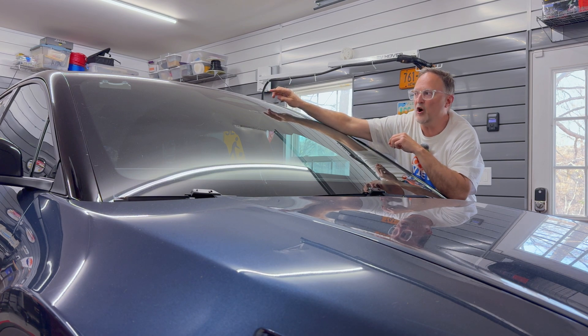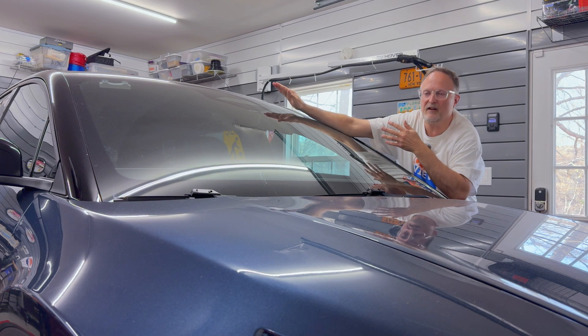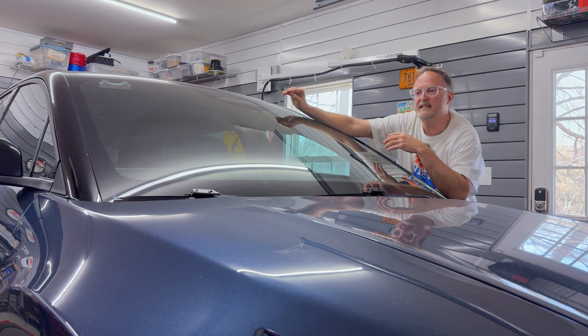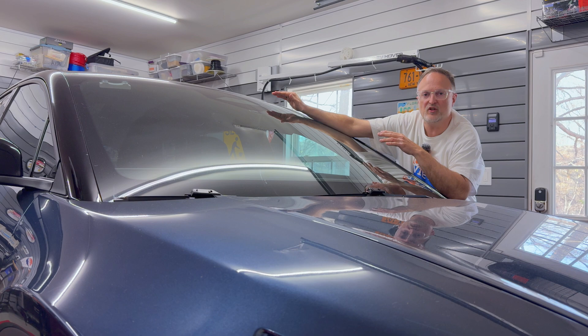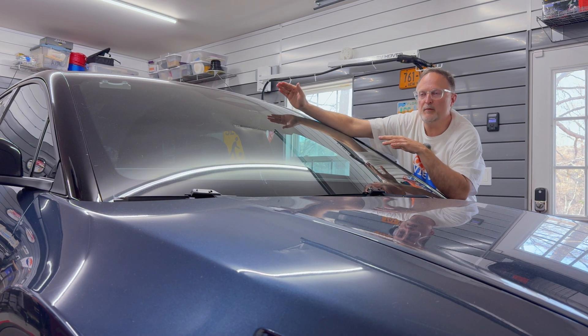One method is opening up the cover where the fan is located, disconnecting the wire, and reconnecting it. Though from what I've heard, that is not really effective, but I still wanted to show the method in case people are interested. The one that definitely fixes the issue is using the CAN bus and resetting the DTCs. That's a little bit more involved, and I'll show you that whole process. So let's get started.